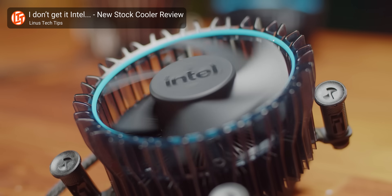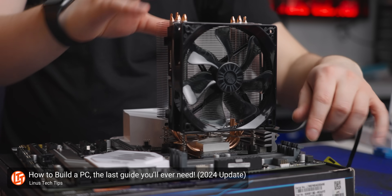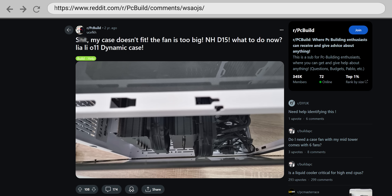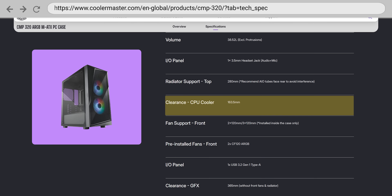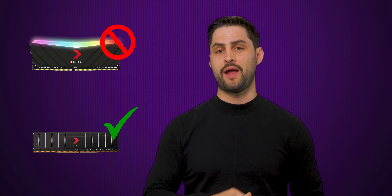Next, let's talk about your heat sink. If you're going with a stock CPU cooler or a water block, this probably isn't something you need to worry about too much because they're pretty small. But if you're installing an aftermarket air cooler, this is where things get a bit tricky. Air coolers can keep you from installing RAM in the slots closest to your CPU, especially if you have RAM sticks with tall heat spreaders. And just as bad, they can keep you from reinstalling your side panel, depending on how far the cooler sticks off from your motherboard. The way to prevent this is to carefully look at the listed dimensions for your cooler, case, and any potentially conflicting components. Some case spec sheets will tell you straight up what the tallest cooler you can fit inside is, which can help eliminate some guesswork. And if you absolutely must have a super wide cooler, some of them can play nicely with low-profile RAM sticks.